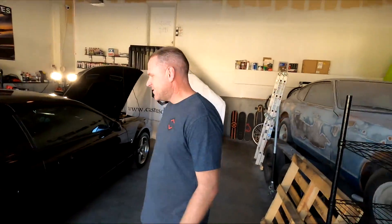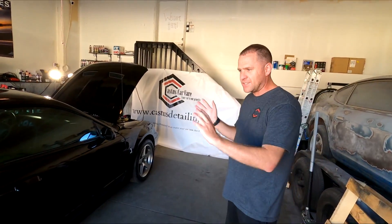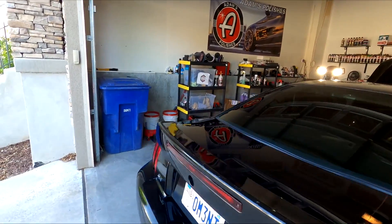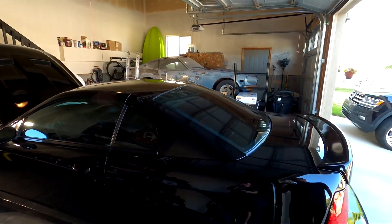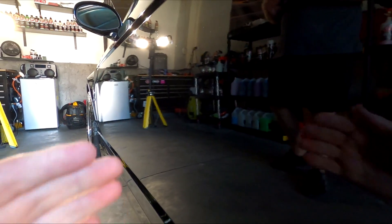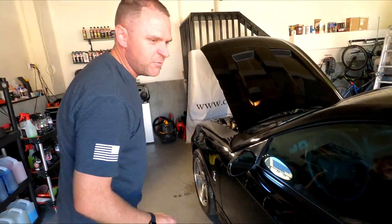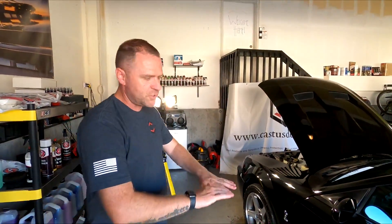Please tell me, what did you do with this Terminator? Well, the first thing I did was measure the clear coat just to make sure that I wouldn't burn through anything as I was working on it. We began with just a quick wash to get any excess dirt off of it, and then we moved on to a two-bucket wash — soap bucket and a water bucket. Then I rinsed it again and pretty much clayed it. I spray it down, hit it with a clay bar, and what that clay bar does is take off any contaminants you can't see or feel. Normally when you first feel the paint they call it a ziplock bag test — you'll rub over the paint and it'll feel like sandpaper. But after I detail it, you'll rub over the paint again with a ziplock bag and it's just smooth as ice.